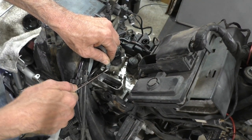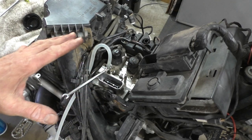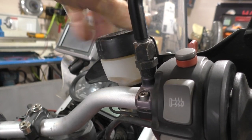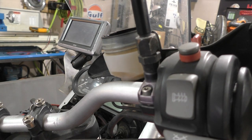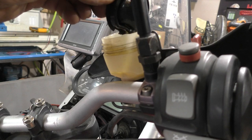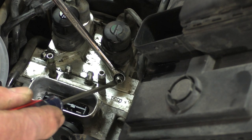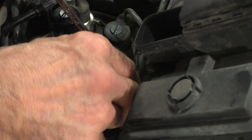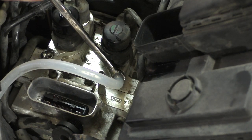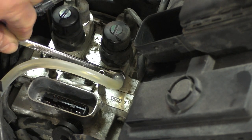That's it for the rear — there is no more air coming out. Now we'll repeat that whole procedure for the front. On the front we're going to use the front brake reservoir. Same procedure but now we're on the front: bleed metering circuit, integral circuit, control circuit. Keep going through those and refilling the reservoir until all the air is bled out. I don't think the front is going to be as bad. You can see the color of the fluid — it really could use a flush.